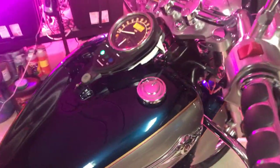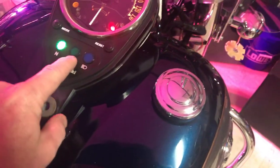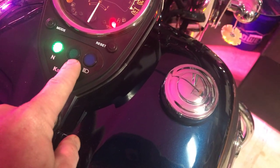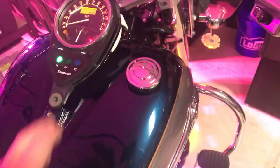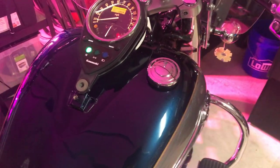What that means is there's an incandescent bulb in your blinker indicator cluster. That is what's causing the problem. You can't see it — it's too dim — but it is flashing. It's barely flashing, but it's pulling a load and the bike thinks there's a problem because the relay is drawing too much load.